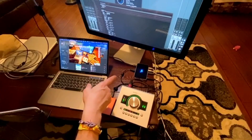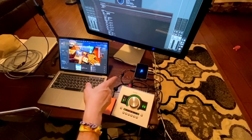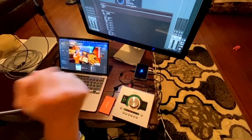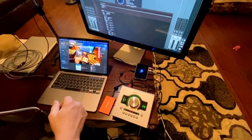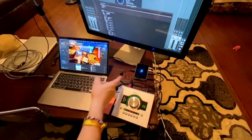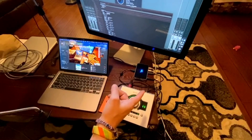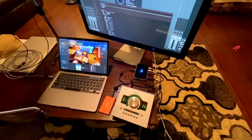On the front, you've got a USB-A Type port 3.2, which right now is just powering my light. The Thunderbolt port on the front of the unit is the upstream port, and that sends all three of your Thunderbolt slash USB ports to the Mac and also carries power, which is nice and convenient. That leaves your other Thunderbolt port on your Mac — Thunderbolt 4 in this case — to my Canon M50 USB port.